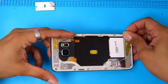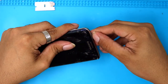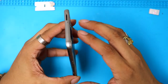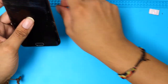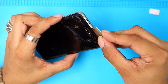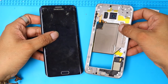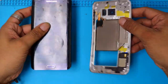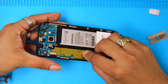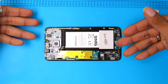After removing the screws, remove the sinker. Now this silver frame is gonna come out. We're gonna use our razor blade, just lift it from the top to the bottom like this. It's gonna open very easily. Put this on the side and we have everything exposed right here.